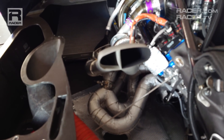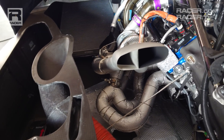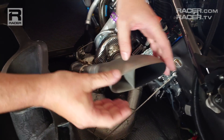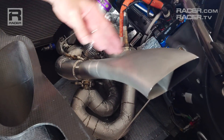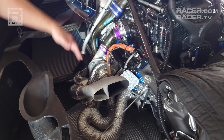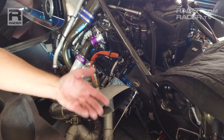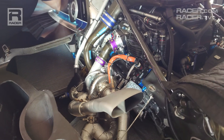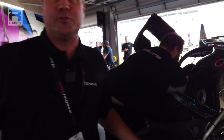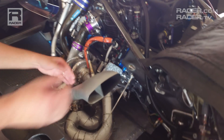With the exhaust — just for those who haven't seen it before — we have the traditional exhaust with three outlets coming out of this bank, but we have also integrated the wastegate outlets and exhaust outlets together. We do so to make sure you have the least restriction on your engine, but also to be compact, help the aerodynamics of the car, and make it very light. We use 3D-printed technology in order to make this exhaust, so that you can define a very nice shape.